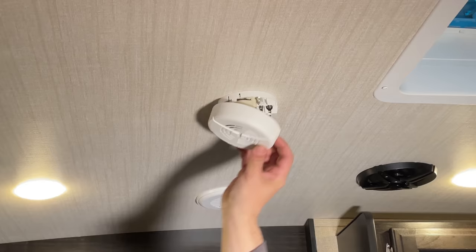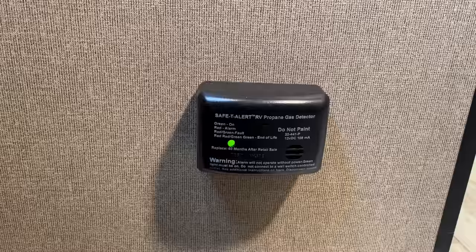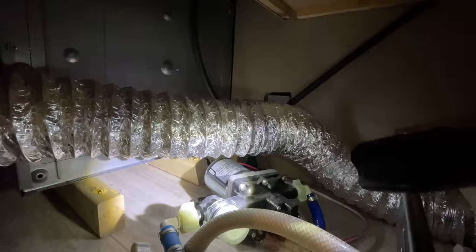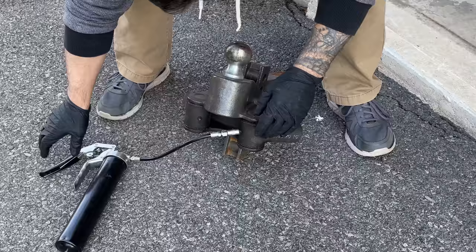This is a good time to replace the batteries in your smoke detectors and carbon monoxide detectors. Check the light on the propane or gas detector to make sure it's also operating. I'll also shine a flashlight along the floor and behind cabinets — this is a good practice to find any evidence of mice or other animals that may have made their way into the RV. A flashlight will also reflect light off of water in dark, hard-to-see areas, so you can check to see if there were any leaks over the winter. If your hitch has grease fittings, that may not be mentioned in an RV owner's manual, so I'll hit these at this point too.